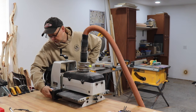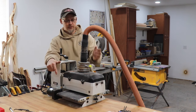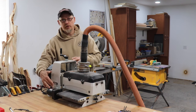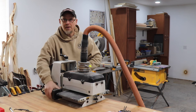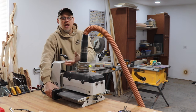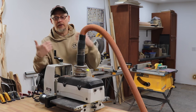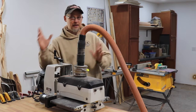They sent me a new motor but it still wouldn't work. Then I went through debating with them about whether the control board or the motor was bad. I said if you plug it in and there's no power going to it at all, how could it be the motor? They eventually sent me a new control board — that took about another month. I got it, rewired everything, and it was working.